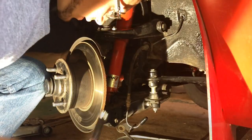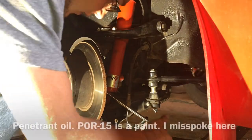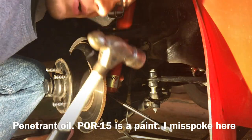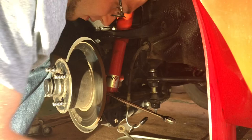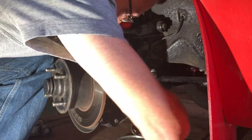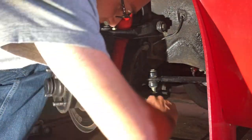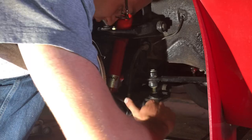Impact is always a great idea on bolts like this, because studies have shown that just simple impact force — just giving a couple of taps to something — releases better than any type of soaking with penetrant oil. So that's what I always use: just a few taps to loosen something, and then I slightly tighten and slightly loosen it, and I rarely break bolts using that method.